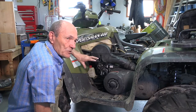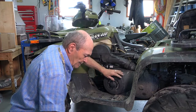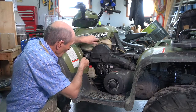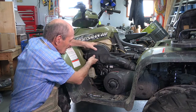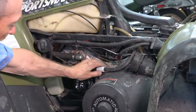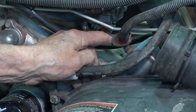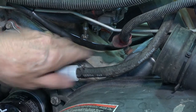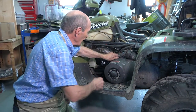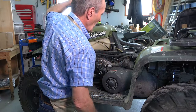Let's see if we can figure out why this starter is not spinning. First of all, you need to take this off — this is the air intake for the belt drive and clutches. Fortunately that's very easy to get out; it's a single bolt. Guess what size it is. 10 mil. Take that bolt out and this lifts right out. Now you can see the starter — there it is way down there. You can also see this wire here with the red cap, which is the power wire that runs to that single bolt on the side of the starter. The starter is bolted to the frame and the frame is grounded with a heavy black cable running from the battery. All we have to do is get power to the starter by turning the key. Every time you turn the key to start, it clicks — but nothing's happening down there.